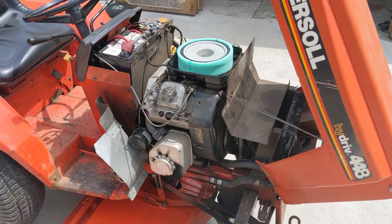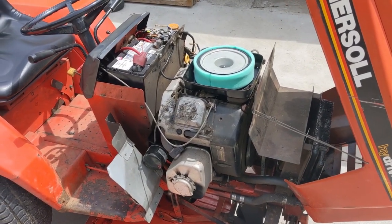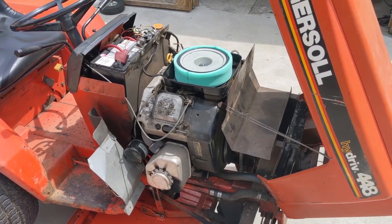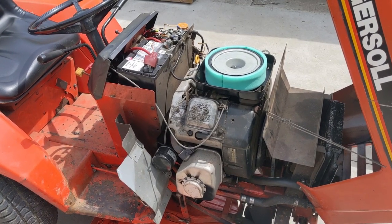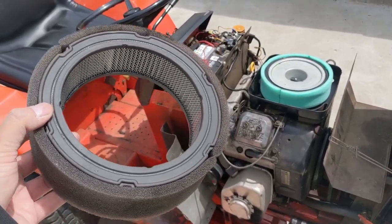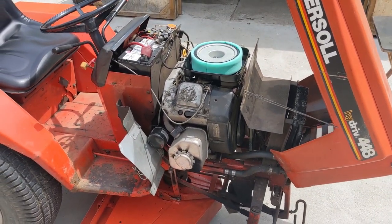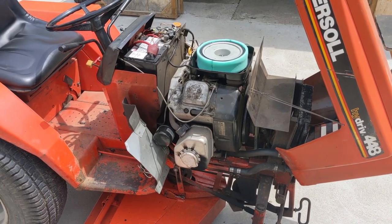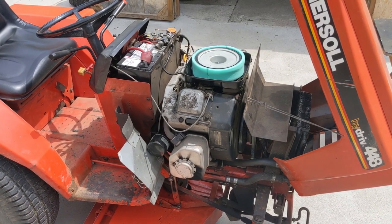In all my years of doing small engine repair, this has only happened to me twice, so this is a very uncommon issue. When dealing with new components, we generally tend to mark them off as something that could be causing an issue because we think they're brand new and perfectly fine. In this case it could be a bad batch of air filters, or this engine just likes the less restrictive Stens filters. This OEM Briggs & Stratton air filter could be filtering a smaller micron of debris whereas the Stens one doesn't filter as finely but is less restrictive — similar to fuel filters I've reviewed in a previous video. Drop a comment below if you've ever run into this problem.